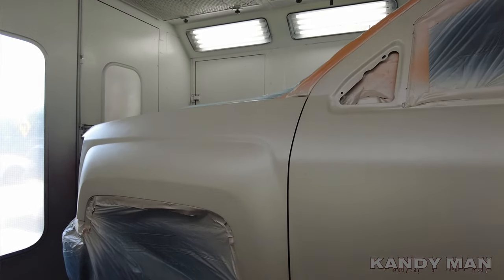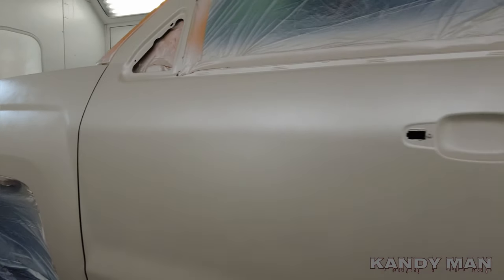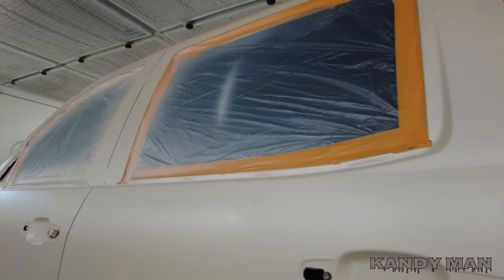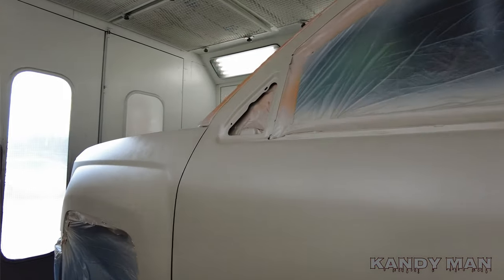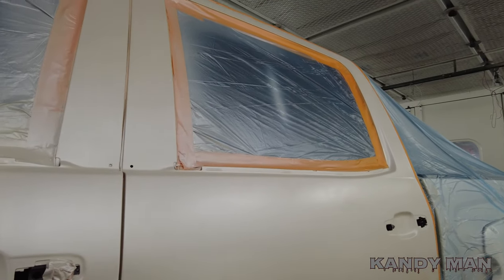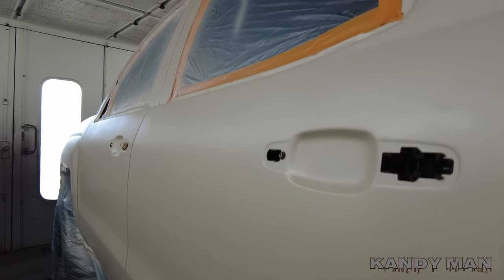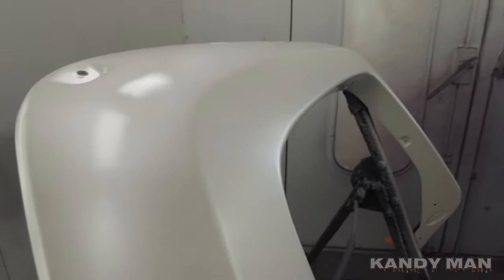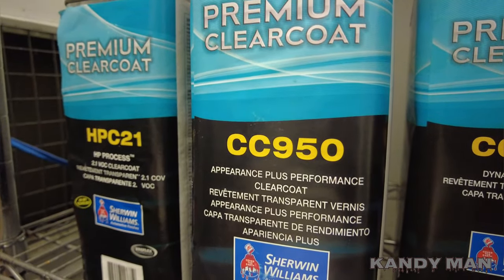You can see now it's all pearled — it's got the three coats of pearl on it and you can't see a blend at all in it. It came out nice and that gun is really working well. I'm a big fan of it already. We got to let this pearl dry for a little while and then come back and clear it. When you milk out that base coat it just gives you a really nice blend — that's how I've been doing it for years.